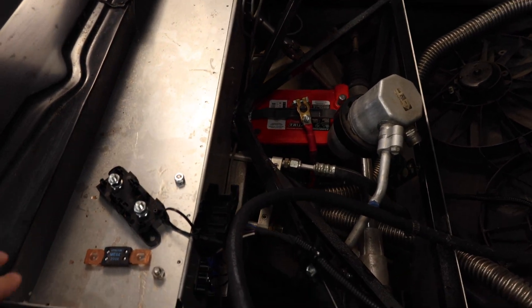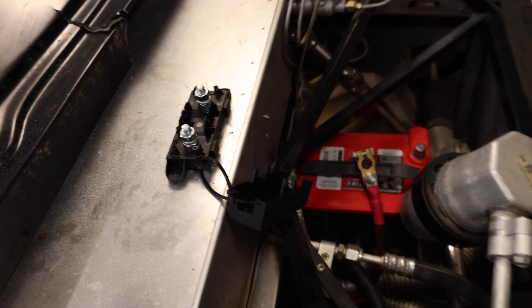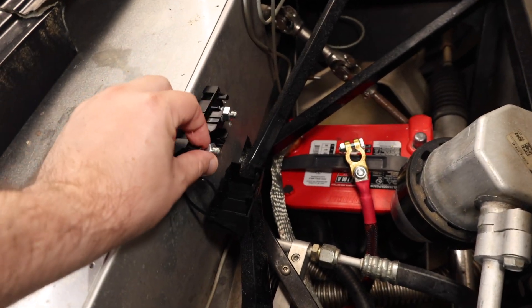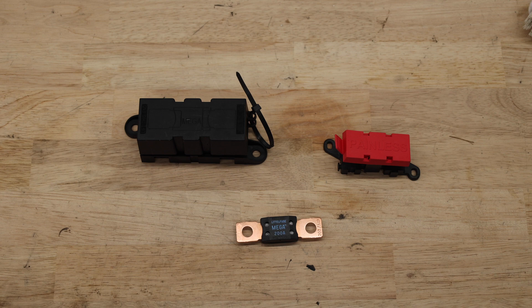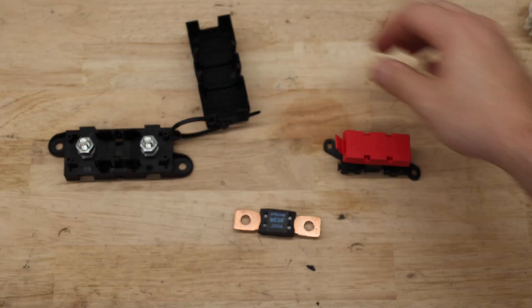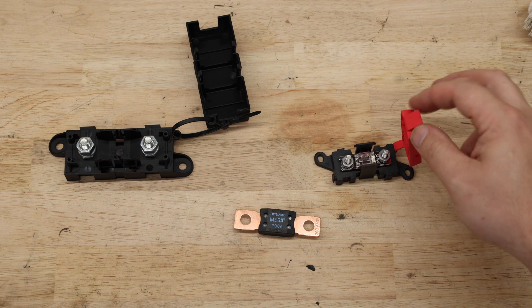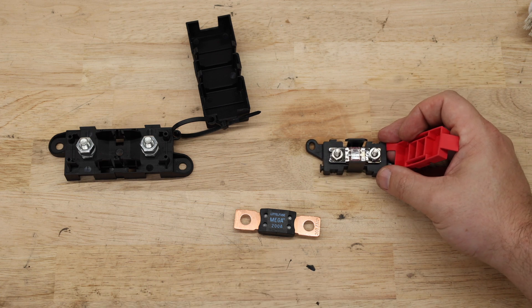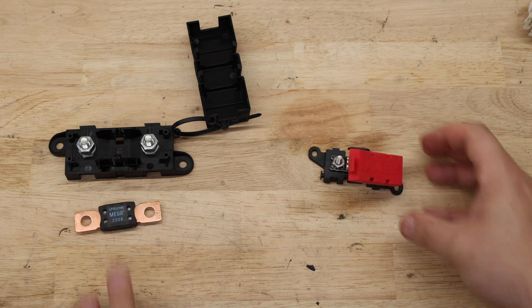Looking at where we're going to be lining this up, we have the fuse here with a few different options. I could put it on top, but then you're doing a right angle from the battery up to the fuse. What I think I'm actually going to do is mount it on this side so one cable comes up and the other wraps around. I ended up getting a little MEGA fuse 200-amp compatible holder — I'll link it in the comments. You can also use something like this Painless setup, also 200 amps. But the big difference between the two is the stud size. Since I'm working with battery cables, I want a larger stud size — this one won't work. So this is the one we're going to end up using and installing.